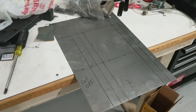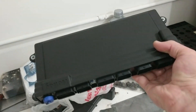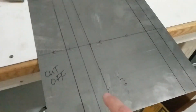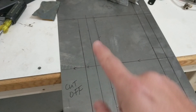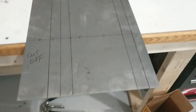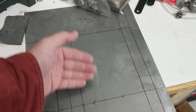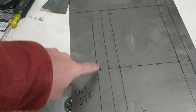It'll sit about an inch off the surface so when rain comes down it'll go under or around it, and the airbox will kind of block mud from being thrown up onto it. I'm probably gonna build some other stuff around it just to protect it a little bit. The Holley Dominator, if you've never seen one, is absolutely enormous — about 12 to 12.5 inches wide, which is why they're so difficult to mount, but that computer can do everything. I'm gonna cut the sheet metal and bend the edges under to make a C-shape.